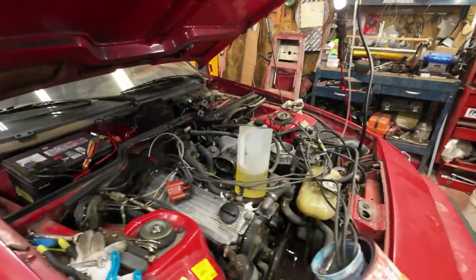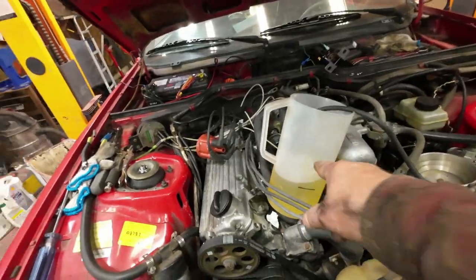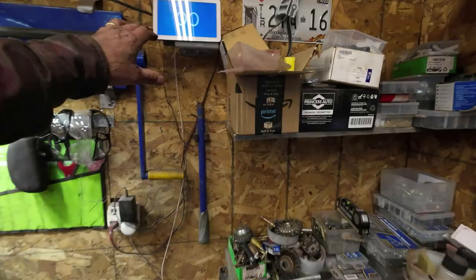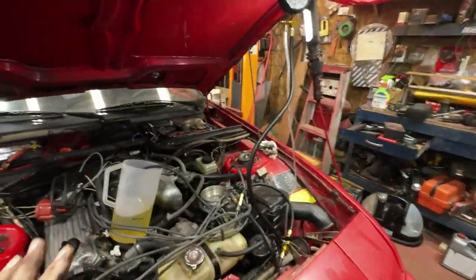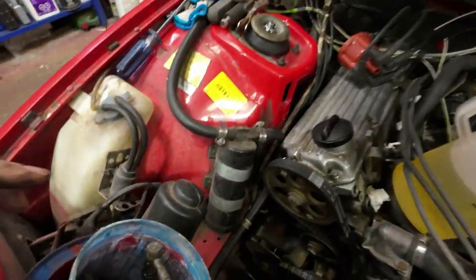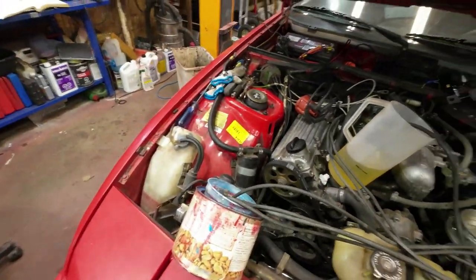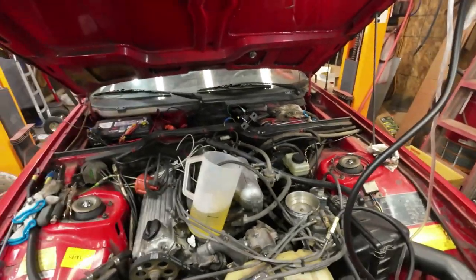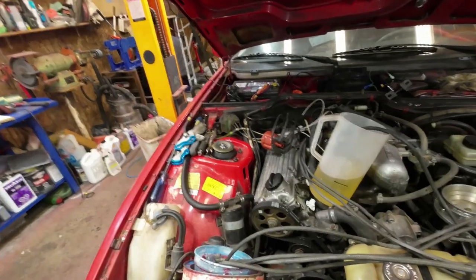Okay, well, looks like we achieved 750 milliliters, no trouble there, because there's the mark right there, and I'm well above it. Okay, all right, Google, we can shut you down now. So it's pumping enough fuel. Now I'll put that back into the tank, and it did indeed pump some into there. I don't know if there's an adjustment in here that I have to make. It must be. Oh well, I'll put the return line back together and put this back in the tank.